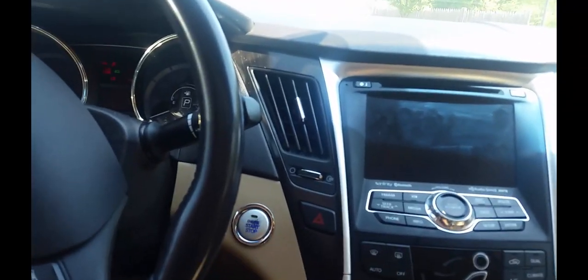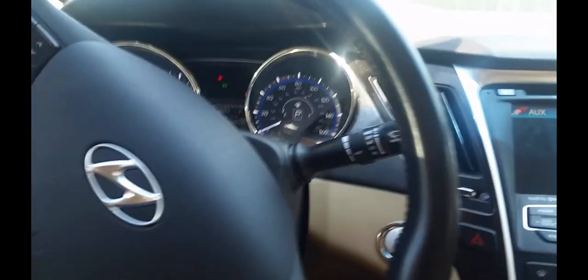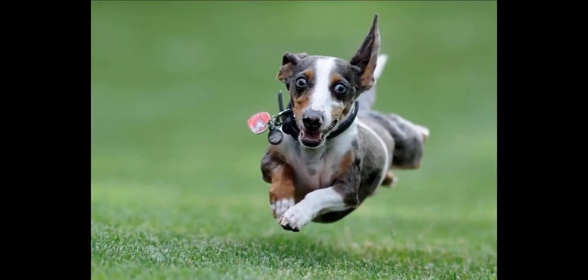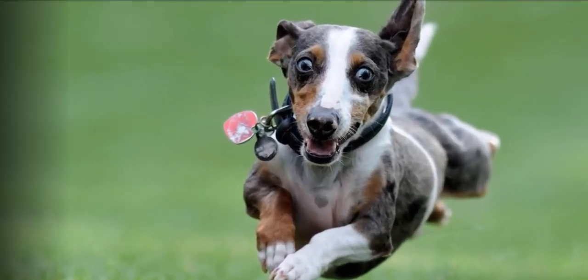Insert the key fob with the buttons up or towards the glove box and start as normal, pushing the start-stop button while stepping on the brake. The car recognizes the fob, even though the fob's internal battery is dead, and starts. And you'll be underway. Don't forget to get new batteries for your fobs.